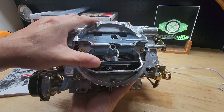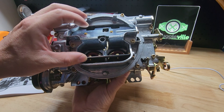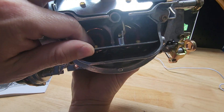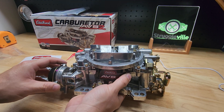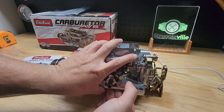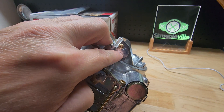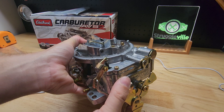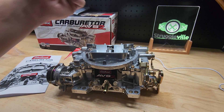Another thing is your little squirters down here — you can see there are two torx screws that hold them in. On my Edelbrock you can access those without taking the top plate off, but here it looks like you have to remove the top plate. You can also change those out and get larger ones if you need. The only other thing to mention is this adjustment for the rear butterfly — you've got the spring, a torx, and a slotted screw, and you can increase or decrease the tension. The Edelbrock Performer does not have that, so I've never played with it.